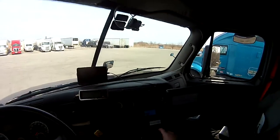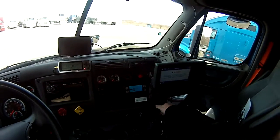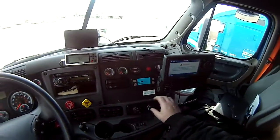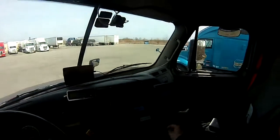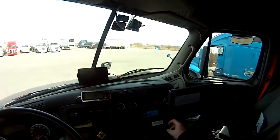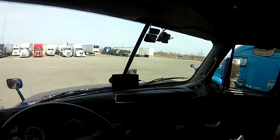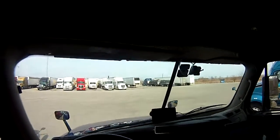Come across and turn on heat and defrost — you've got to put it selected over to defrost, high fan, heat. Feel up here and make sure the defrost is working. Put it down to feet, put your hand down underneath — feel for it, heat's working. Unless you want to roast, turn it back off. So that covers heat and defrost.